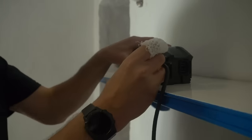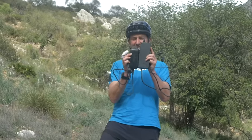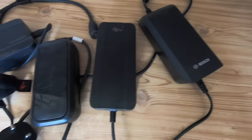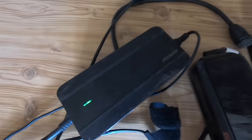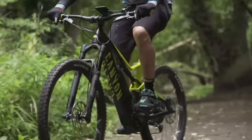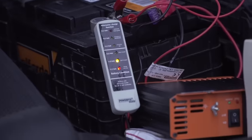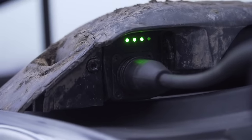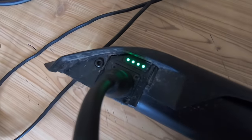Your standard chargers that come with a bike are great for regular day-to-day use — the best of both worlds in size and power output. Lightweight chargers are a great option to pack for big rides; they're considerably slower but handy on the trail. Then there is the car charger, which lets you charge your battery whilst on the move by plugging into your 12-volt cigarette lighter. It's a slow method, but a great way to top up batteries on route to the trails.